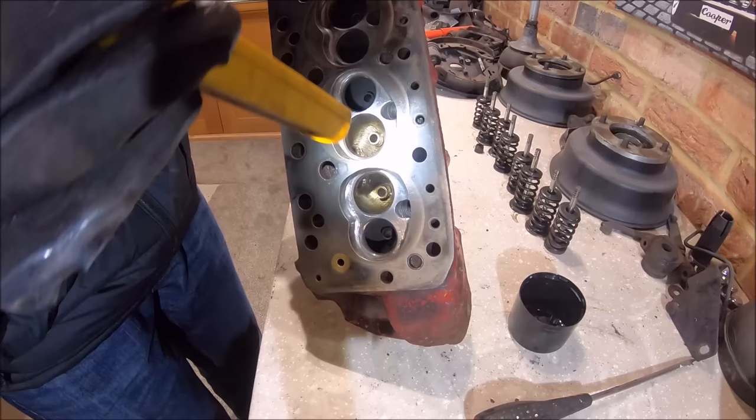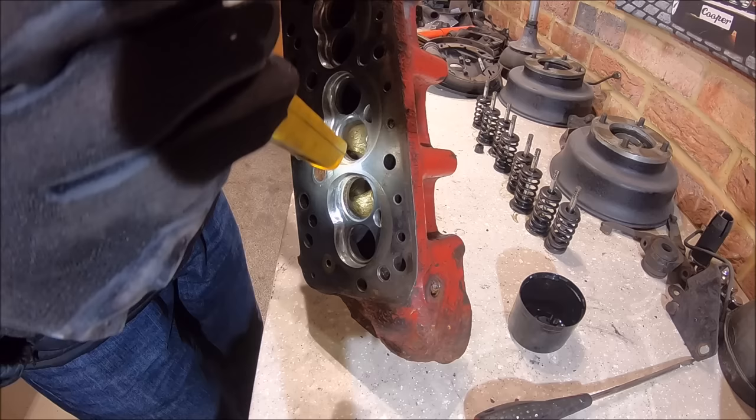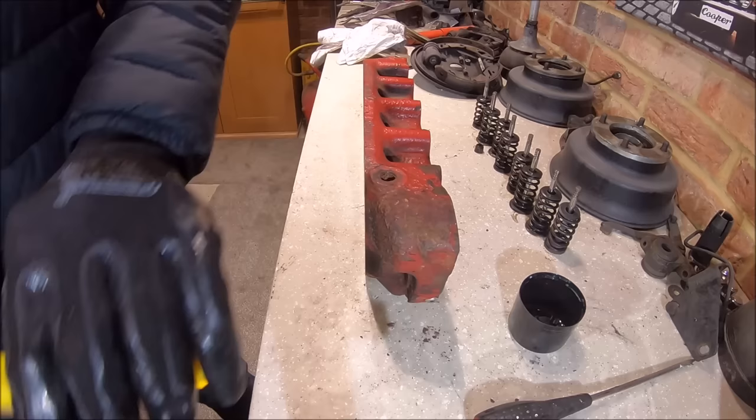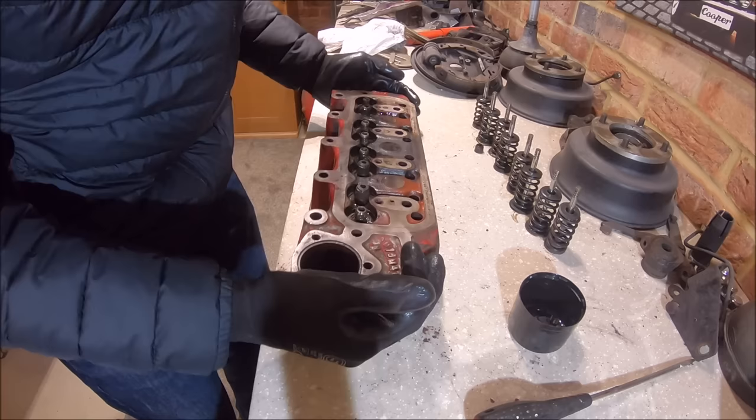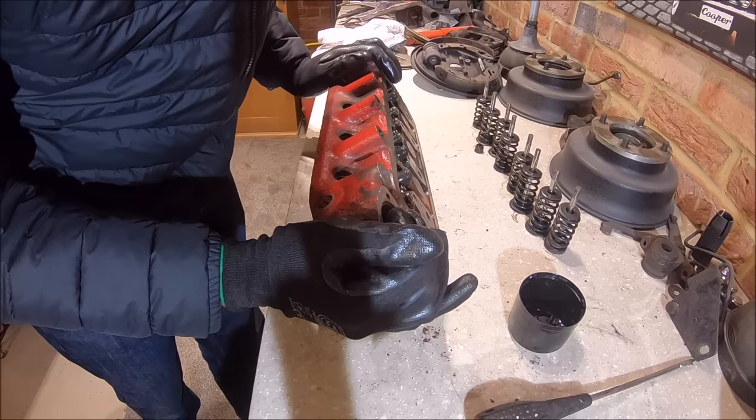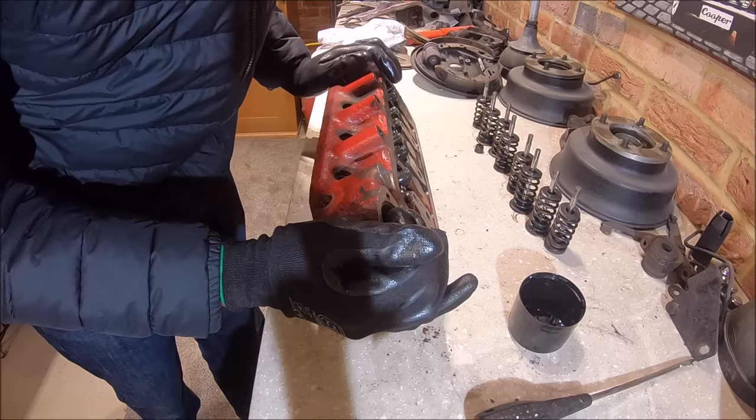As you can see where it's been standing, it's gone corroded on the inlet ports — there must have been a bit of moisture in there, which is a bit disappointing. Also worth noting it has valve guide oil seals fitted — actually, just on the inlets, not all of them. I think most of the time now you'd fit them to all valves.